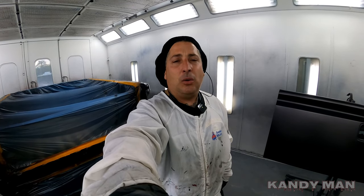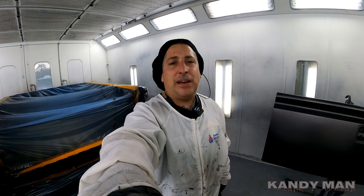I'm going to show you guys what I was telling you about. These new guns are really well made and they break these clears up so well. So sometimes you don't have to go by the manufacturer's recommended PSI settings. Get your clears and try them out. This CC200 I was telling you about is a medium solid. I've been spraying this clear with the C2 cap at 18 PSI with the DV1, and it lays down a beautiful finish. I only give it about a 3-minute flash time.